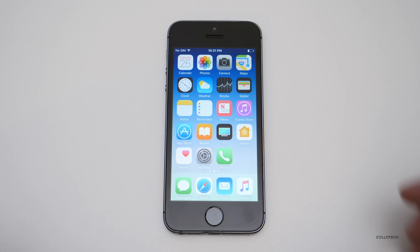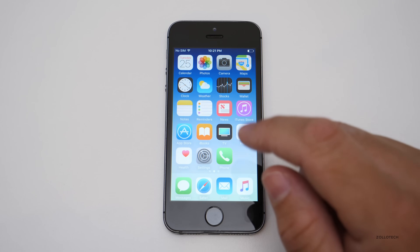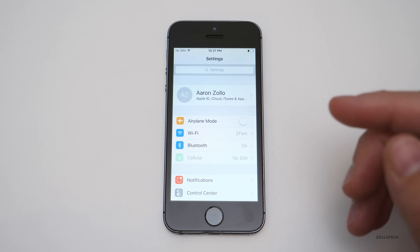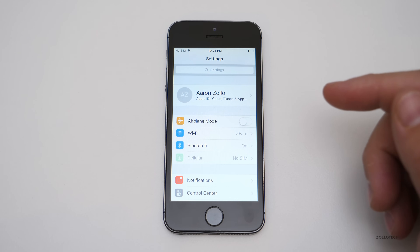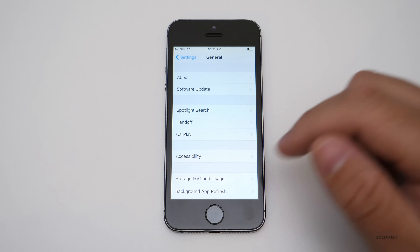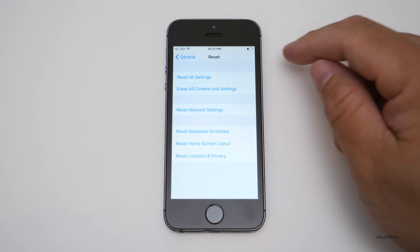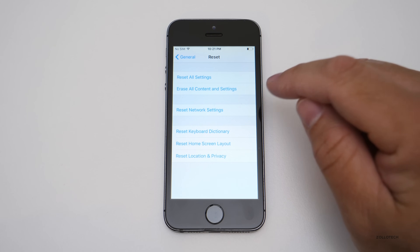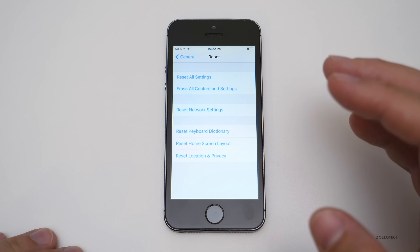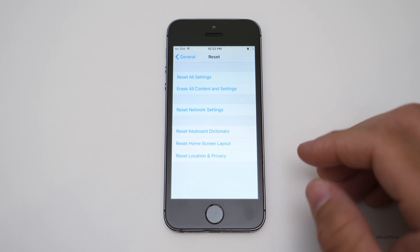Here's the iPhone 5S and we're going to reset it so that it's like new — like the first time we pulled it out of the box. We need to go into Settings, and if you have iCloud turned on and Find My iPhone turned on, you'll need to disable that before you reset it. This will completely wipe the phone, so if you don't have it backed up anywhere — either iTunes or an iCloud backup — you'll lose everything. Just make sure you have everything backed up that you'd like to.